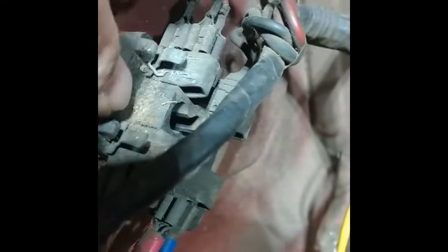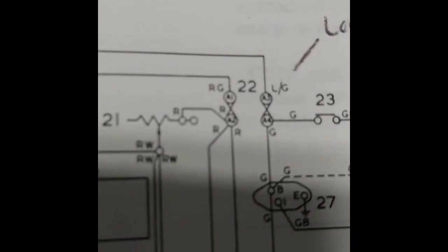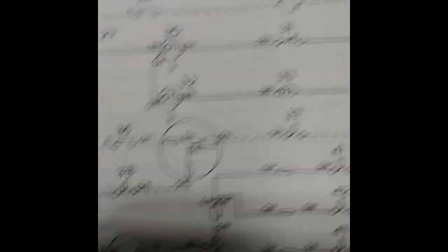Of all the lights, I had one headlight working and played around for a while. I got this headlight working — found a connection that was pulled out — but still couldn't get any other lights to work. It turns out the lights come through this upper fuse, all but the headlights. I had plus 12 here but not here, which would make you think the fuse is bad, but the fuse was good. It's actually corroded underneath this clip, so I'm trying to clean that right now just to get it working temporarily. I'll probably put a new fuse block in. The other fuse is for stuff that comes on with the ignition, like gauge lights. There's the two fuses, and the lower one is for all the lights, gauges, and so on.